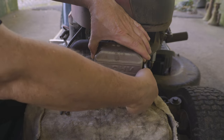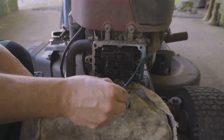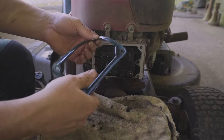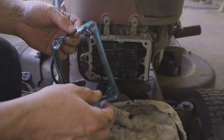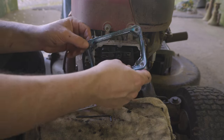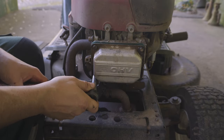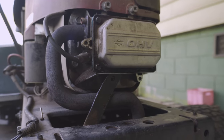Next, I did a valve cover gasket. This was the one I felt had the most chance of failing because of the heat, especially since it was really near the exhaust system. And it did not fail in that it never leaked. But in my opinion, it failed at least the reusability factor because of something I tried when printing it — this was the user error I was mentioning. I should have printed it solid and not messed around trying to make it softer. I'm going to print another one at 100% infill and try this test again. It did not fail on the machine, but it tore out around the edges in some places, compressed too much, and is permanently deformed. After taking it off, I did put it back on just to see if it would leak — and it didn't. So it's still functionally working, but not to the degree I would consider a success.